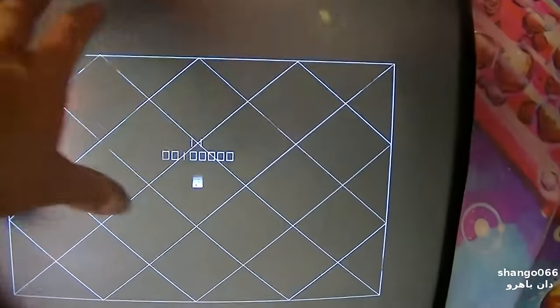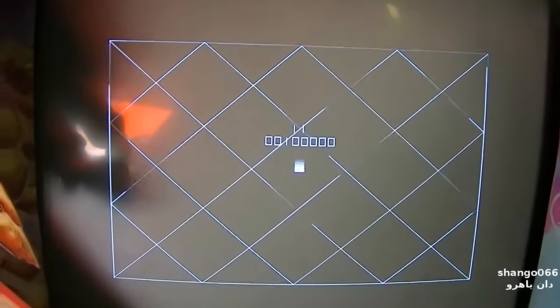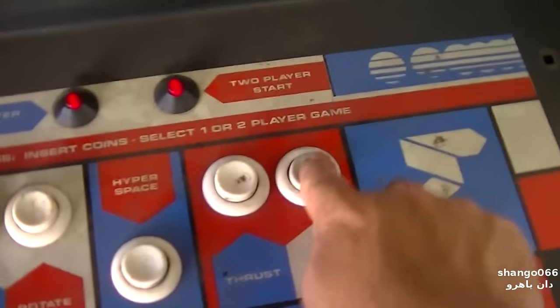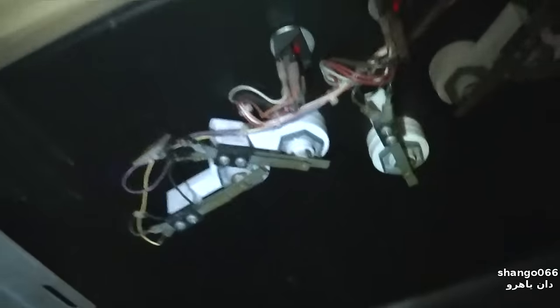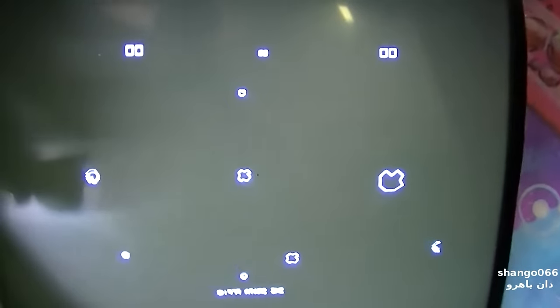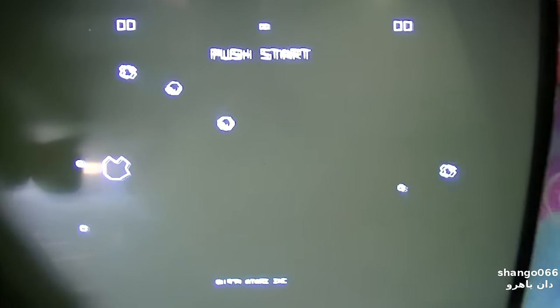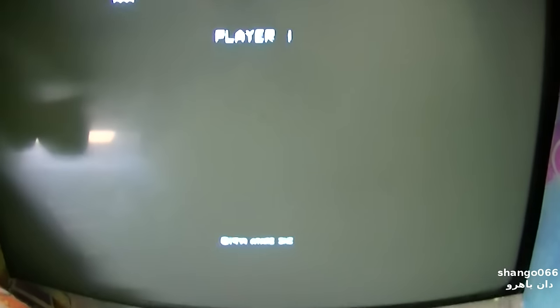I looked at it up here - it looks good. I checked this connector. What a problem child this thing is. When I'm in test mode here you can see it's not filling the screen. I think I've got this figured out - the ground wire here is broken off, that goes over to this one. So I'll just fix that real quick. Okay, we got game! Now it's just too bad that it's not filling the screen - I think it's supposed to fill the screen.